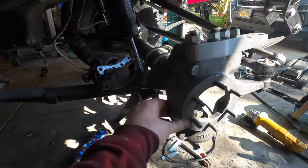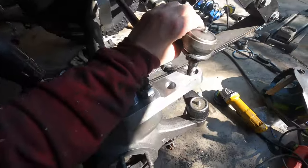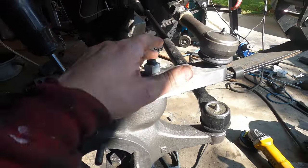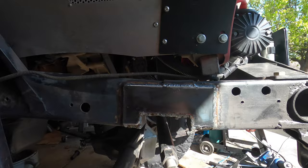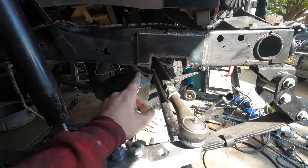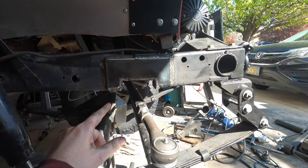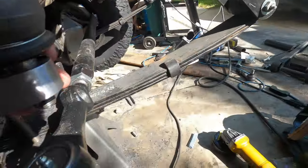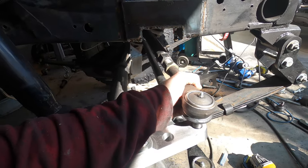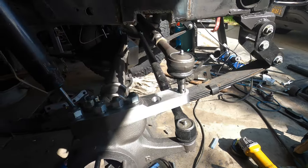Time lapse. We've got the new knuckle put on, the thick high steer arm torqued down, and we swapped out some tie rod ends. Now everything's lining up pretty good. One problem I had forecasted — I knew this was going to happen — is the frame getting in the way. You can see here we notched it. I took an inch and a quarter up, so it's about a third of the four-inch frame. Then I boxed it in with eighth-inch rectangular tubing and framed around it with three-sixteenths. Pretty heavy duty. We just welded it all the way around, and it gave us probably about an inch and a quarter more clearance than we would have had. Now the axle can come up that high and we already have probably an inch and a half of up travel — plenty.